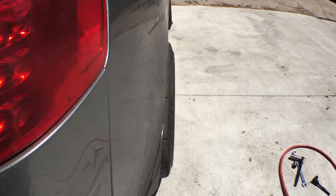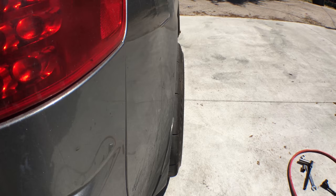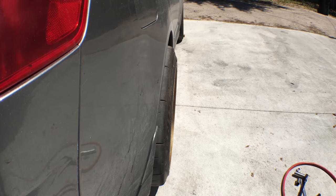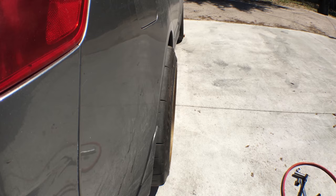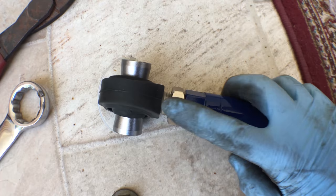It's really hard to tell what your toe is when it's up in the air like that, but there is somewhat of a distinction. Right now it looks pretty good to me by eye — obviously eye is really not very good to go by. I'm gonna go get a proper alignment, but you want to set it up decent so you can drive it to the alignment rack and it's not going everywhere. Now a little trick: if you ever install on these arms, make sure the distance from this side is the same as the other side.